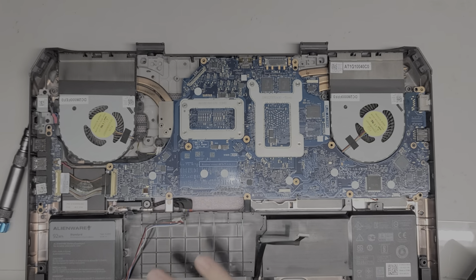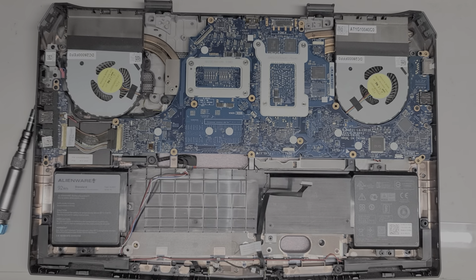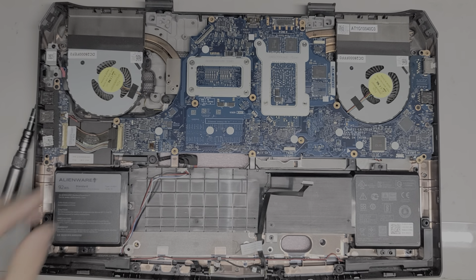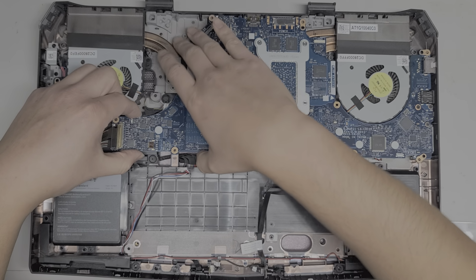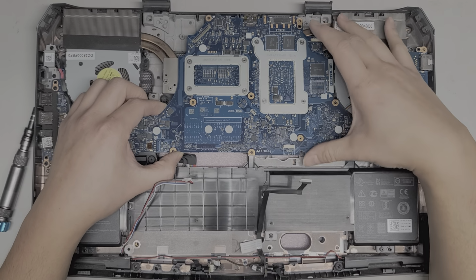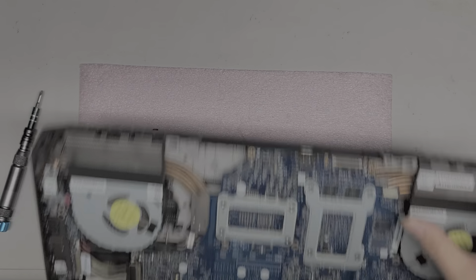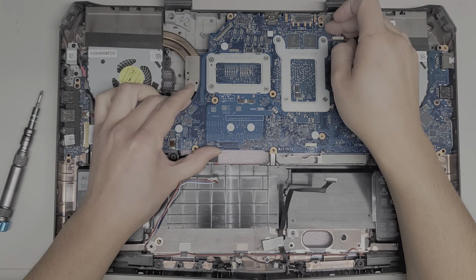And now we're going to continue with the main board. Let me set the screen aside somewhere safe. Okay. And then we got the main board now. Now that we got the hinge out, we should be able to hopefully lift this up. Looks like it's still getting caught somewhere. Okay, let's see here. Is there something back there holding into it? The HDMI port feels like it's getting caught. Okay, so we kind of have to wiggle this, it looks like.